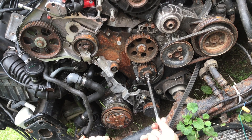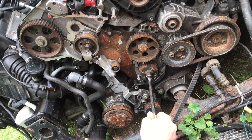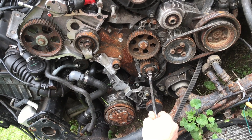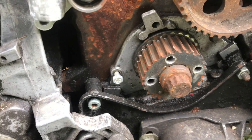Went a little bit too far. You'll feel it gets real easy once it gets to top dead center and it's easy to go past that. Now we have the valves lined up on the timing mark and we have the crankshaft on cylinder number one at top dead center.